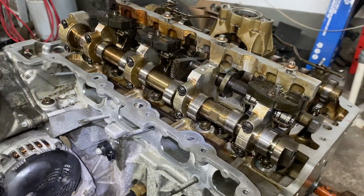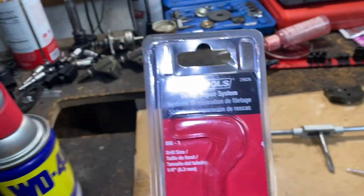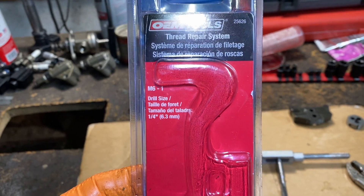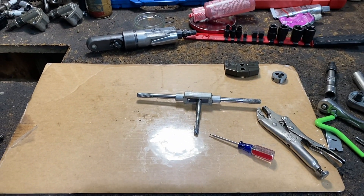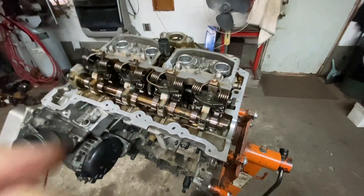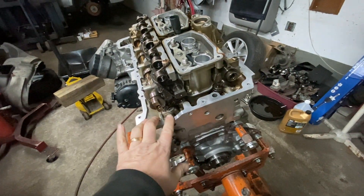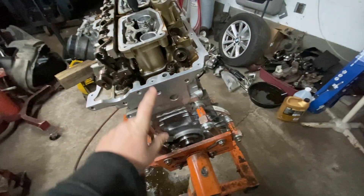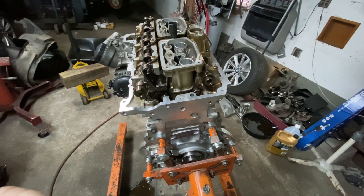The kit I used was OEM Tools, 6mm by 1.0 pitch — they come in all different sizes. Please subscribe, hit the like button, leave any questions below. Just to clarify what I said earlier: thread repair kits are not recommended for cylinder block threads where the head meets the block. That's what I meant — I wouldn't recommend that repair for those threads.